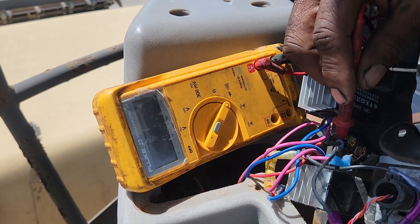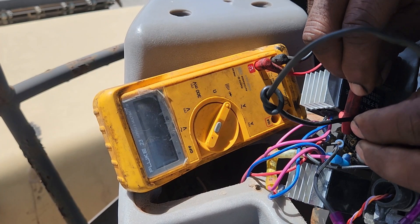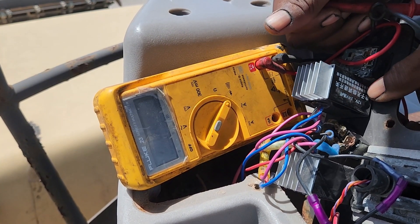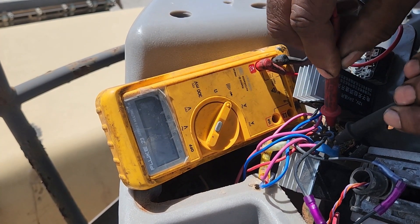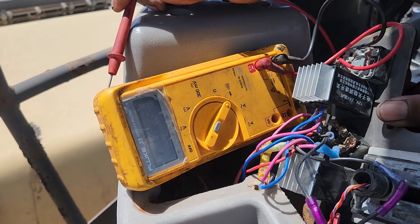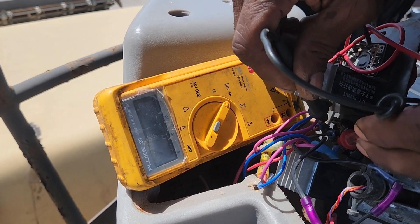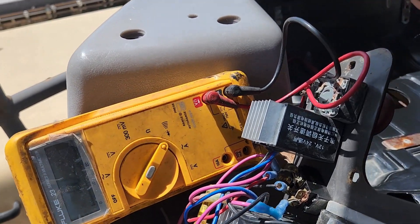Okay, so it's intermittent — it's not making a good connection. So that part of the switch is bad. I push it the other way to the back — okay, to the back — hear the beeping? Now push it the other way; it should be this one and this one should read continuity. Nothing at all — hear that? That means you've got a bad switch.